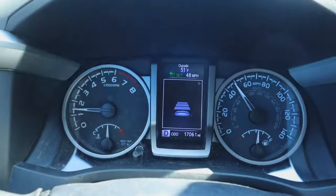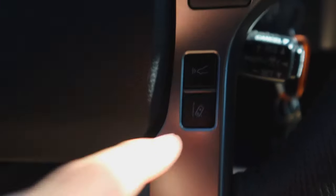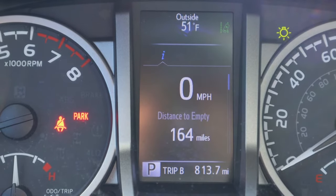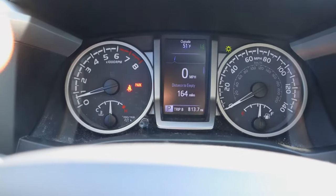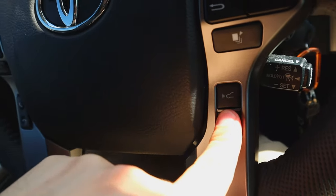This first button is for radar cruise control. You can set it to have one, two, or three car lengths in front of you — I'd recommend option number two, since number one is a little touchy. The bottom button is lane departure. This one is very nice, but I'd advise not setting it to high sensitivity, because it'll beep at you for even thinking about crossing the line. Keep it on the lowest to medium setting and you'll be okay.